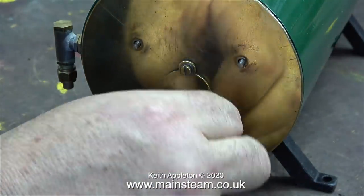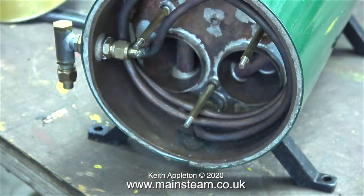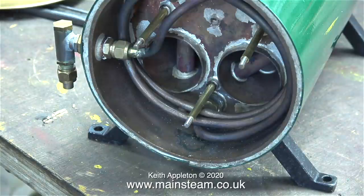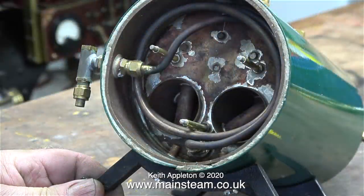One refinement is a really nice little keyhole window where you light it at the front. The main similarity between this boiler and Mike's is that this has two flue tubes, and both of these flue tubes have cross water tubes fitted, as you can see here. The coil of copper tubing inside the front of the boiler is not a superheater — it's a water economizer, and its job is to preheat the water before it goes into the boiler. The pipe goes in at the bottom and connects to the check valve at the side.